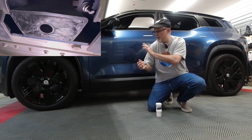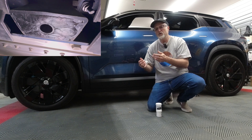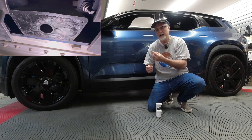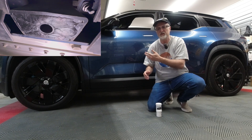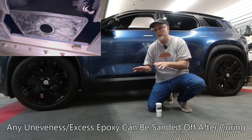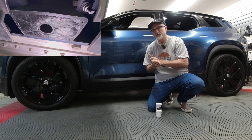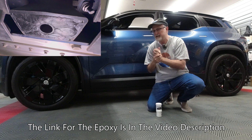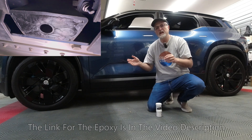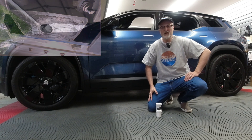Make them noodle-thickness and push them up in there with the chopstick as far as you can, since it's about two inches deep. Make sure you don't go over the edge and don't go inside the circle area where the lift puck needs to go — keep that circle area clean. Fill the other four areas up to the edge. I think it worked pretty well. I'm going to be testing it out this weekend by rotating my tires for an upcoming trip. If you have any questions or comments, please leave them below. Thanks for watching, and I'll see you in the next video.